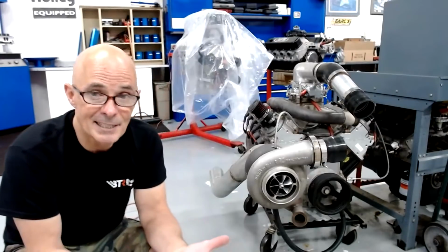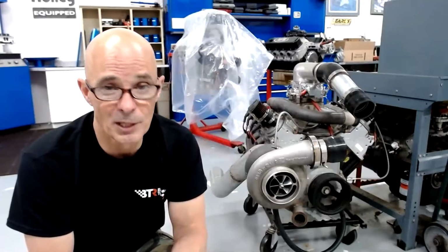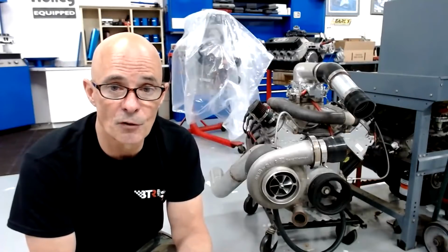Snafu, is porting aluminum Speedmaster 351 Cleveland heads worth the investment, or would the money be better spent on some TFS Cleveland heads? I've never compared those two. We ran a set of ported Speedmaster heads from Bryce over at Dr. J's when he was in business, and they worked really well. They flowed very well.